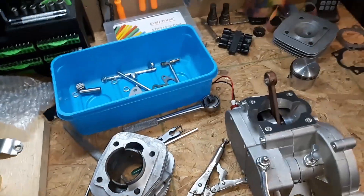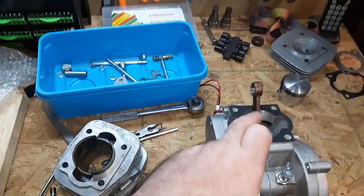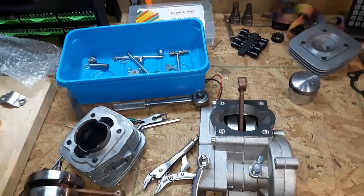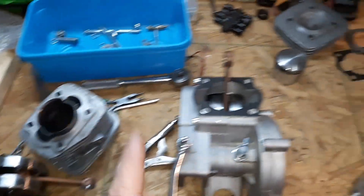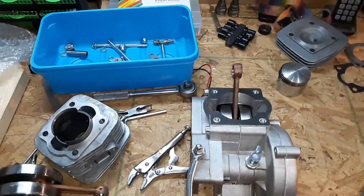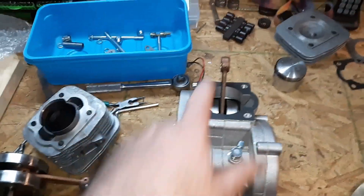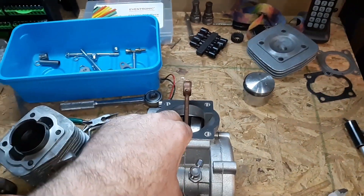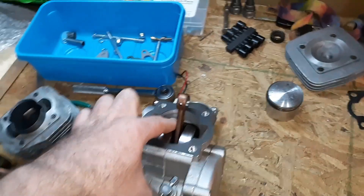There are some issues with this — definitely manufacturing issues. We're missing 3.5 millimeters and the crank stroke length is way off for what this should be. It should be a 40 millimeter crank — this YD100 one here is 41.2. In the next video, we'll put this on, time it all out, see how bad it is, dissect it, and see if I can put a YD100 crank in it with this rod. These 37mm cranks are great for saw builds — and now I know why they come in these kits and people end up dumping them.